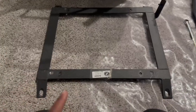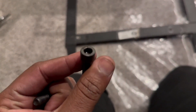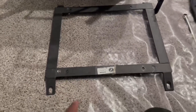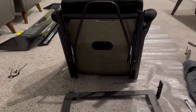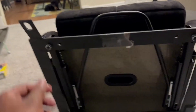I got my first two holes drilled and I have some bolts here that came with the NRG seats — they're 8.8 grade bolts with 8.8 grade nuts as well, and we've got some lock washers. We're going to put it on and see how well it fits in the front, then measure out to do the same thing for the back.